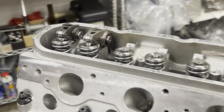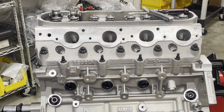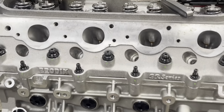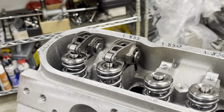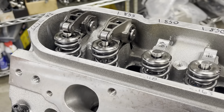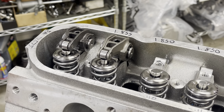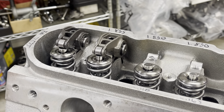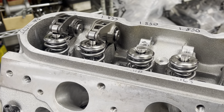Hey guys, this is Anthony and Alec at HP Research and we are going to be talking about how to do push rods. This is going to be our LS7 heads, which will take factory rocker arms. You can see we're using some Texas Speed roller tip rockers, but these are fixed rockers. Everybody always asks: how do I know if I have the right push rod, or how much push rod preload do I need on my lifters? We're going to assume that you don't know how much travel your lifter has. We've already marked this one up, so we kind of know where we're at right now.